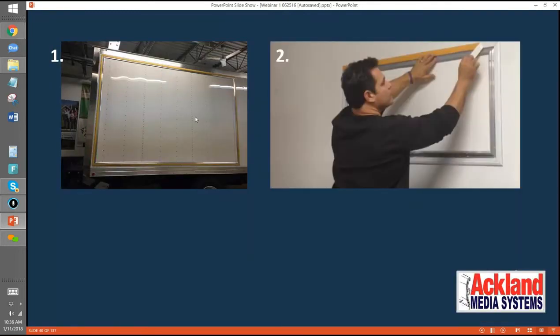First, make your picture frame — we call this the base plate. Once it's in place, you pull off a tape liner on the perimeter. It's an inch and a quarter wide strip that holds your vinyl in place — like having 20 sets of hands all the way around, holding the vinyl until you get the top cap on. One thing everybody asks: when I change it out, do I have to change the tape? The answer is no.